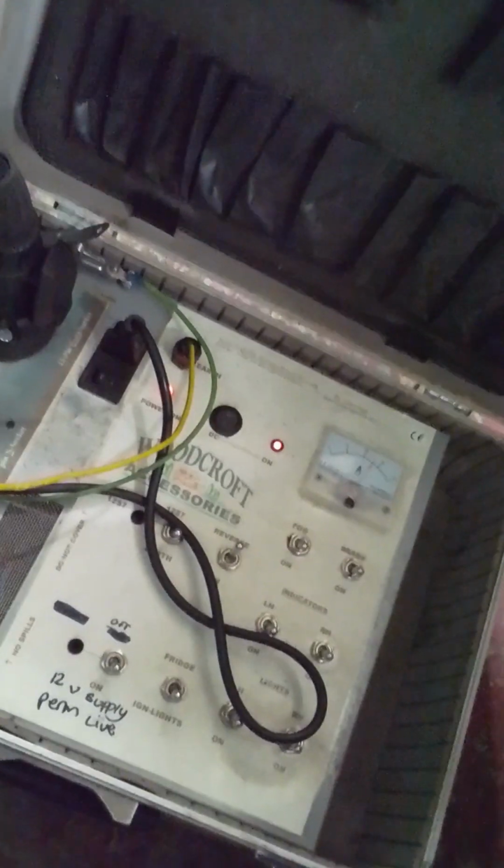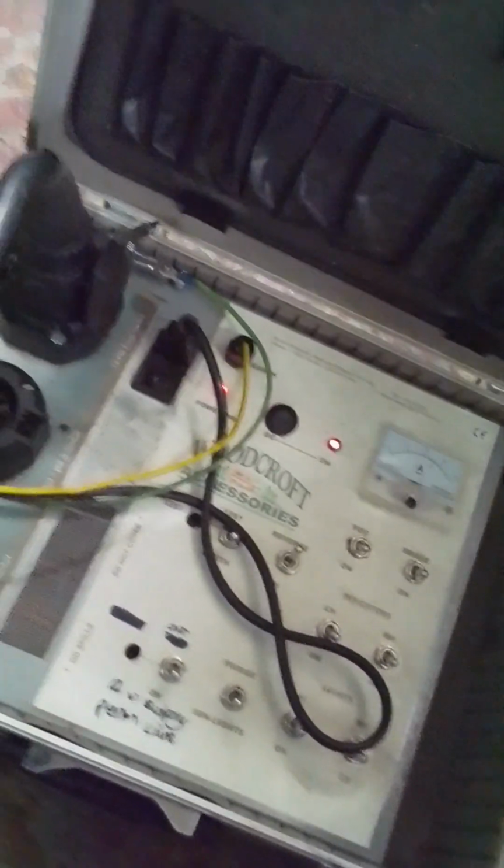You've got your breakaway cable, jockey wheel, handbrake, 13 pin plug which connects to your car and does your exterior lights and 12 volt to the fridge if your car is wired up correctly. Also here we have your gas locker, you have your bulkhead regulator and obviously two spaces for two 6 kg propane gas bottles. As you can see, we have lights on around the van, including your awning lights, like so.